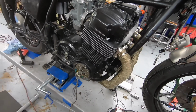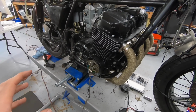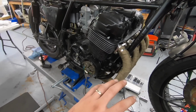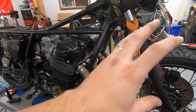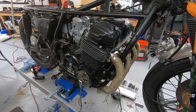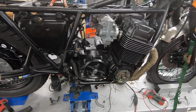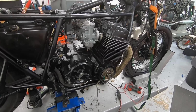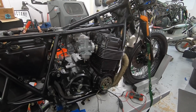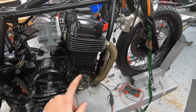I'll probably get the bike up and running first with the original point ignition, because it's always a good thing to start with a good running bike before you tear into the ignition system, just to take out all the other variables. And since we've changed so much about this bike, I want to get it back to running condition and then do the electronic ignition. I've never actually heard this bike run. The owner tells me that the bike has kind of putted around the block, but personally, I've never heard it run. So that's still to be determined. But that'll be in the next video or two. You guys will see me get everything done to the point of getting it running, and then upgrade that ignition.